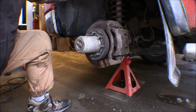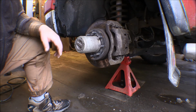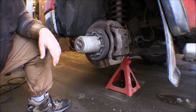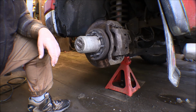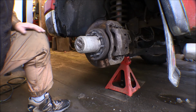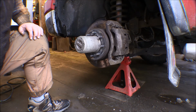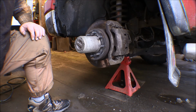I can reach in through this way and change that fuel filter a lot easier. But I got to looking in there, and it looks like one of the wires going into the starter is fraying pretty good. Now I don't know why that thing would be having a problem. There's nothing gets in there on that starter wire. But I think what I'm going to do is take this fender liner off on this side so I can get access to that side of that engine and check out that wire going into that starter, and also change that fuel filter.